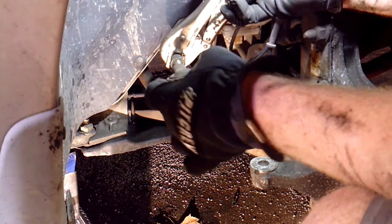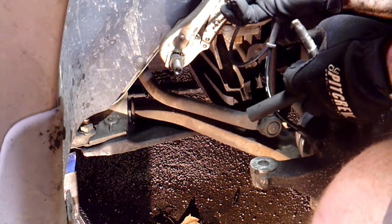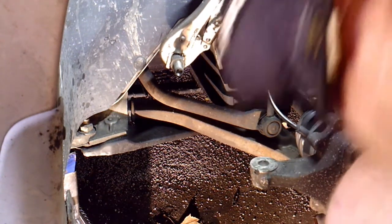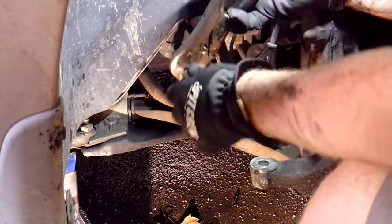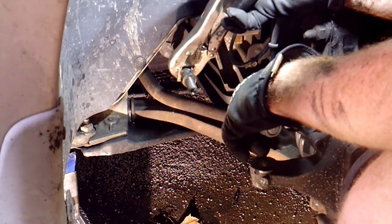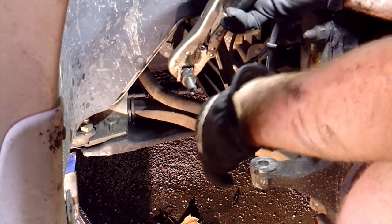I started out like this with it facing down, and then one full turn would be facing down again, obviously. Not to make it oversimple, but if you haven't done it, that's just how I do it. So it's 22 turns off, which is Joey Logano's number, so that's how I remember it since I'm a NASCAR fan. Now we've got to pull this nut off because we're going to pull that bellows off, the boot kit, or the boot, and this clamp, so it won't come off.